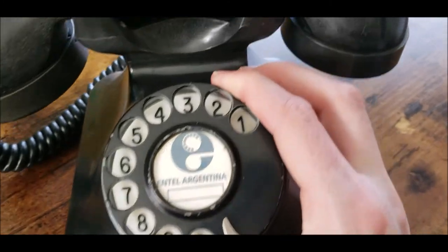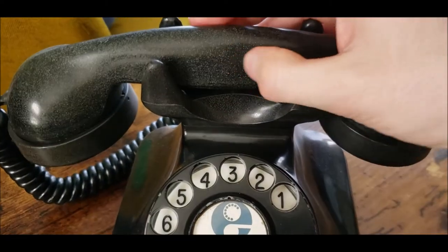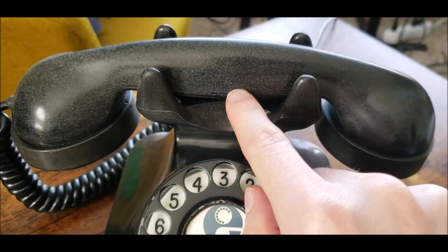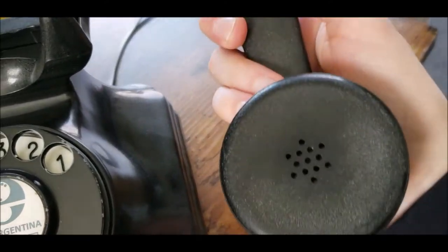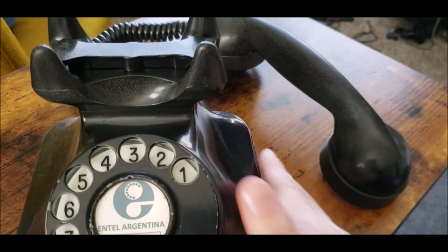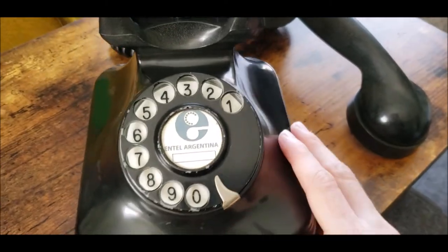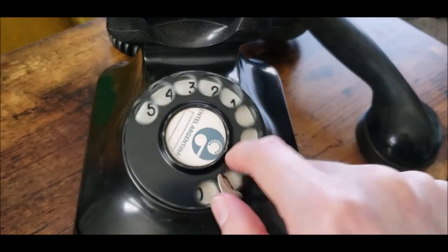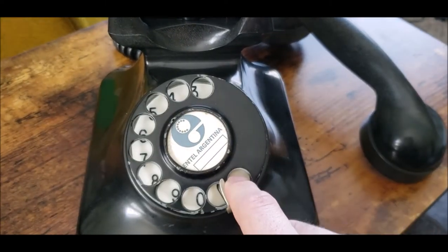Here's a look at the phone. The restoration was a success — the bakelite is in good shape. You can see some roughness in the bakelite on the handset from use, with some spots that are not dirt, just the bakelite deteriorating naturally. Pardon the dust, I just got it off the shelf. The dial has been adjusted, cleaned, and oiled, so it has a nice smooth return.